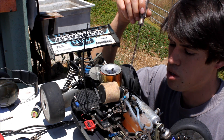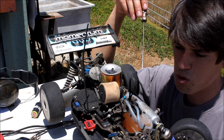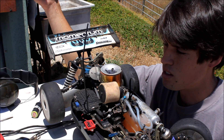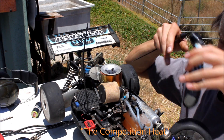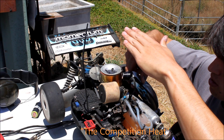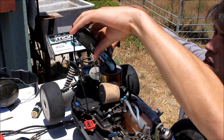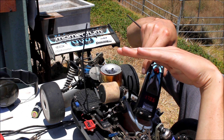It will blubber — like tons of oil will come out. You'll go through a tank of fuel in about three minutes, thirty seconds. You have to keep this thing on, which is called the heat. It's at 280. The heat's at 280, and it only keeps the engine at 170, which is not warm enough.